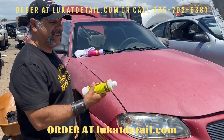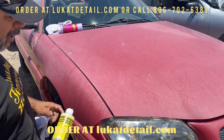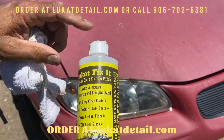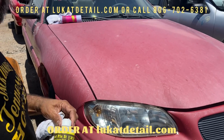Hey guys, look at this paint job. Look at the quarter panel here, hood panel. This is an old oxidized paint job. I'm going to use Lukat Fix It Color and Gloss Restore Polish. This is a paint cleaner. The reason why we need a paint cleaner is because this paint job is seriously oxidized and dirty.